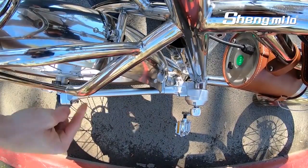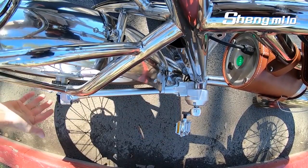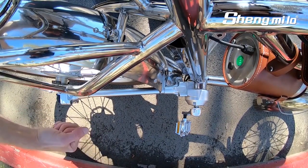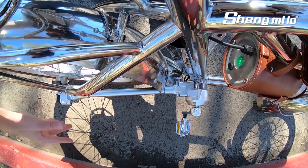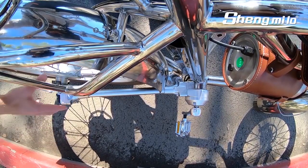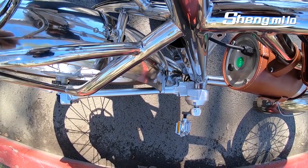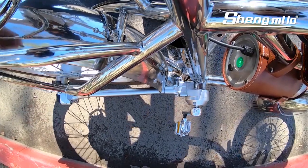There's a little bit of delay in the start and stop. The cadence sensor isn't really visible, so it must be well protected. Trying throttle mode — it kicks on smoothly. So maybe it offers 90 newton meters of torque, but to me that's kind of misleading — it's got a nice smooth ramp. Yes, it's a bigger and more powerful motor, and the smaller wheel diameter gives you mechanical advantage, but don't expect it to launch like a rocket ship. It's actually pleasant that it's smooth, given that this is more of a neighborhood cruiser.